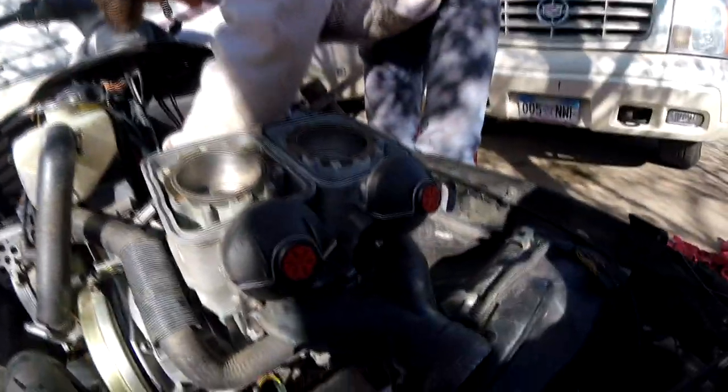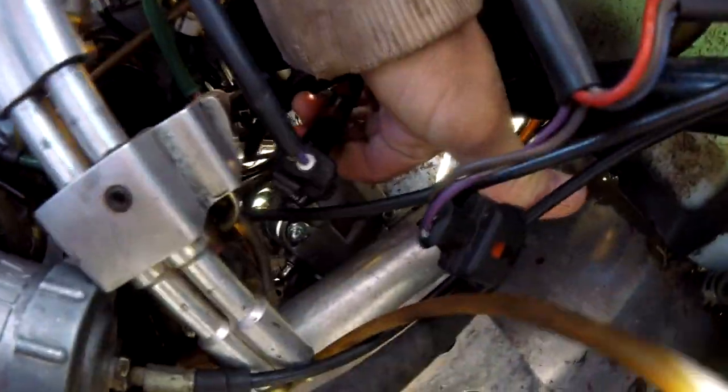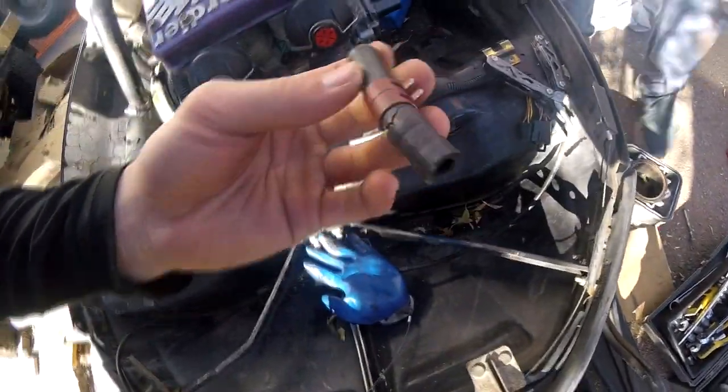Put the seals and rings on and we're ready to put the cylinder head on, get the carbs attached, and we're ready to start this thing. Wait — look at that, guys, that's not good. Can you see that? If you can easily pull it out, it's bad. So now we've got everything back together almost. We got the cylinder head on — or the cylinder cap — we've got to get the spark plugs in. But then we were putting the fuel pump in and realized my pulse line is completely shot — it has cracks everywhere.